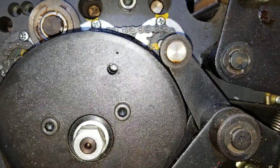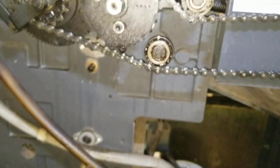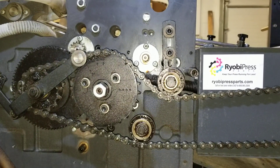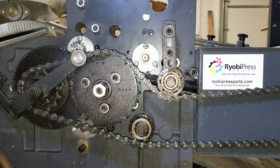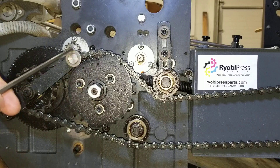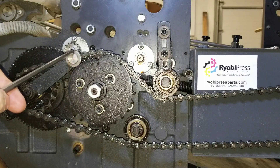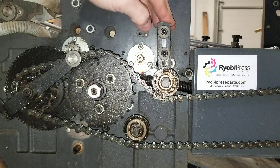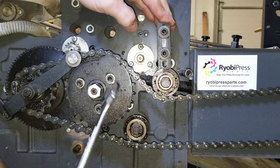If you look right through there, you can see there's no hole in the side frame, so we're going to move to the non-operator side. We're going to loosen the tension sprocket. Right now these two dimples should be lined up with the vacuum cutoff arm. I'm going to loosen both of these Allens — this is the tension for the chain. I'm going to put a 19 millimeter on the back nut, not on this front nut, just so I can hold it.